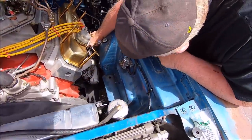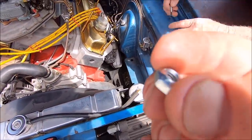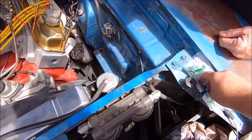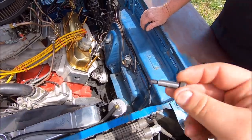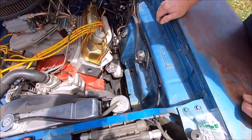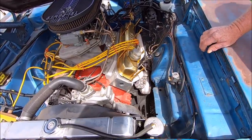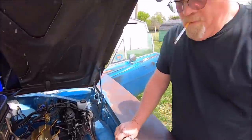All right, so we're back from the hardware store. We got a little crimp metal locking nut, better than a nylock. That little nylon will go bad. And there's our shoulder bolt, and that's going to tie everything together. Now it's going to get everything to fit really snug. So that's version 2, and well, version 1 only lived about 8 hours. So hopefully this is better, Dan.